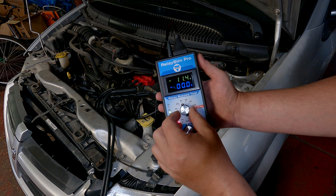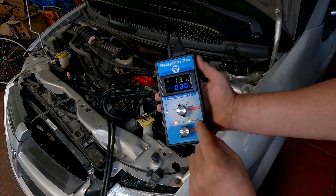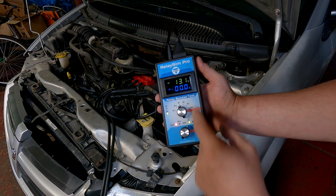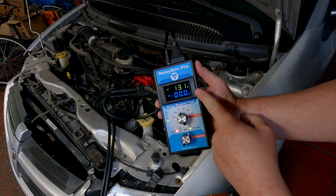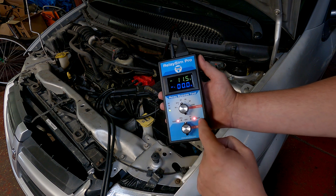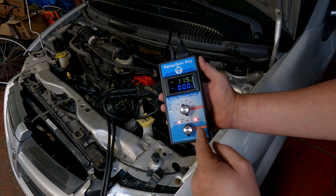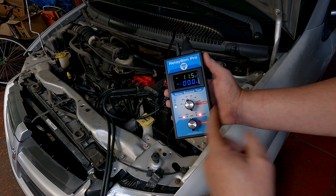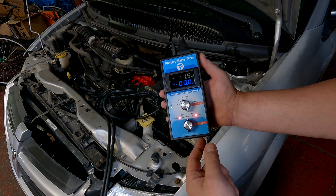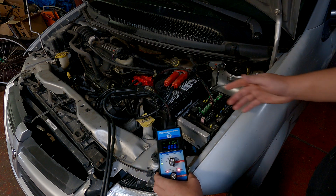Going over to 87, we have about 11.5 volts, so we don't have full battery voltage. The chances that this is shorted to power are pretty unlikely. More than likely, we have an open circuit. If we put power to 87, we get battery voltage — the green light comes on, the fault light goes off. So we know we don't have a short to ground, but we also know we don't have a connection to a component because we have no current flow. Very confidently, we have an open circuit between pin 87 and our front blower motor. In this case, it's because the blower motor is unplugged.